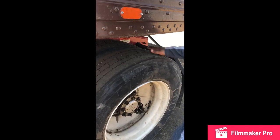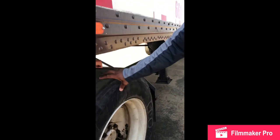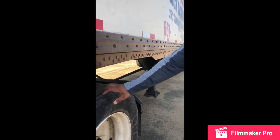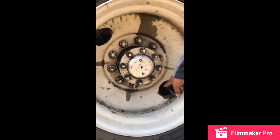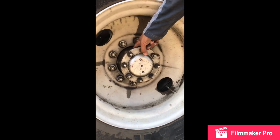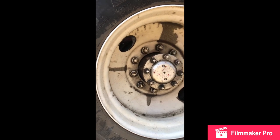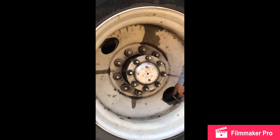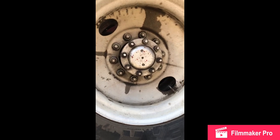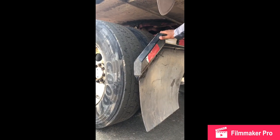My two drive tires: no cracks, no breaks, no bubbles, not touching each other, no stones or mud in between them, always 100 psi — checked this morning, mounted and secure. My 10 lug nuts: no cracks, no breaks, none are missing, no rust, all completely tight, mounted and secure. My hub and hub cap: no cracks, no breaks, always greasy, no leaks, securely mounted with nuts and bolts, mounted and secure. My two valve stems: no cracks, no breaks, no leaks, securely mounted with the cap, mounted and secure. My mud flaps: no cracks, no breaks, not touching the tire, not too low, not too high, securely mounted to the frame with nuts and bolts, mounted and secure.